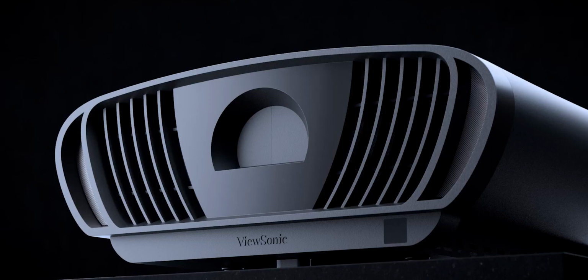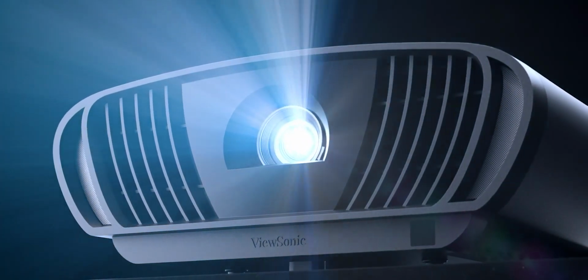You see, portable projectors like this one have a smaller image chip compared to those in dedicated hang it on your ceiling type of home cinema projectors. So while both devices can be in full HD, the projected image on the larger image chip looks sharper, more crisp, and in case of many DLP projectors like this one, has a better contrast. But you cannot put that in a package as small as this one, so compromises. That's all there is to know about this projector.